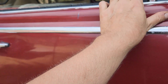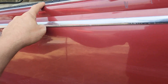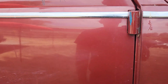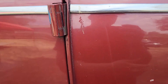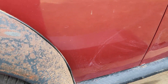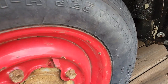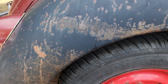The rubber seals are pretty toasty — very toasty. I'm going to assume it's not a Michigan car but a western car, because the weather stripping took a lot of damage. Probably a high heat area with very high temps. There's some filler with bubbling starting right there — common spots. The running boards are shot as always. The back looks like a newer fender, took quite a beating. Inside where all the body mounts are, it looks really good — never been patched, all factory.